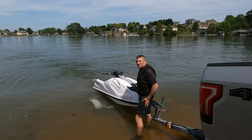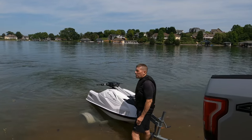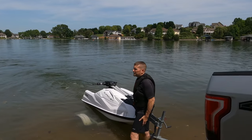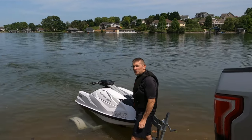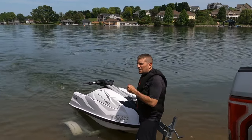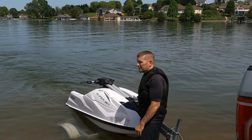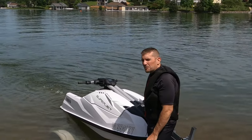All right, guys, we went through the first 5 minutes. I'm going to shut it off. And we've got to ride 30 minutes at low RPMs. I think it's under 5,000 RPM, so I'm just going to ride around on my knees. It's not taking site footage today, just going through the break-in process.